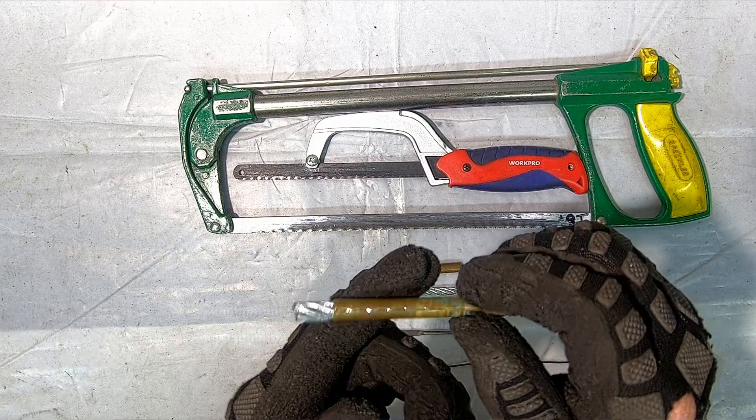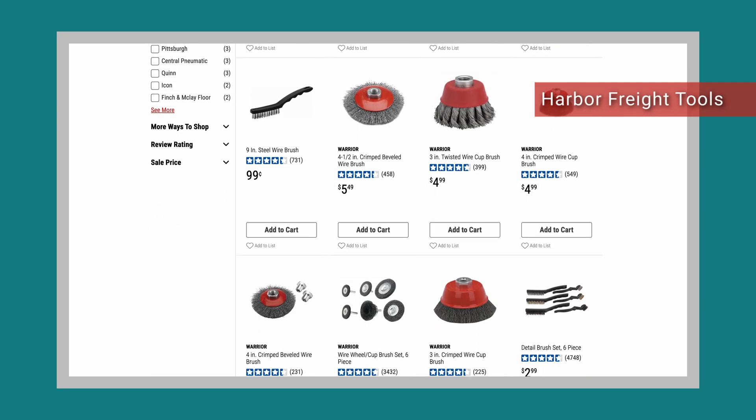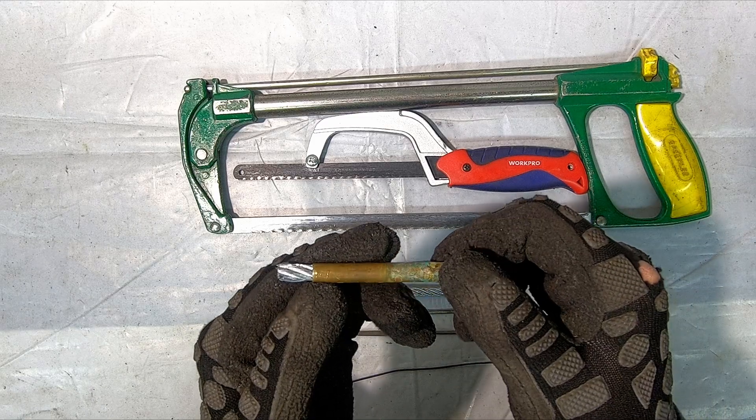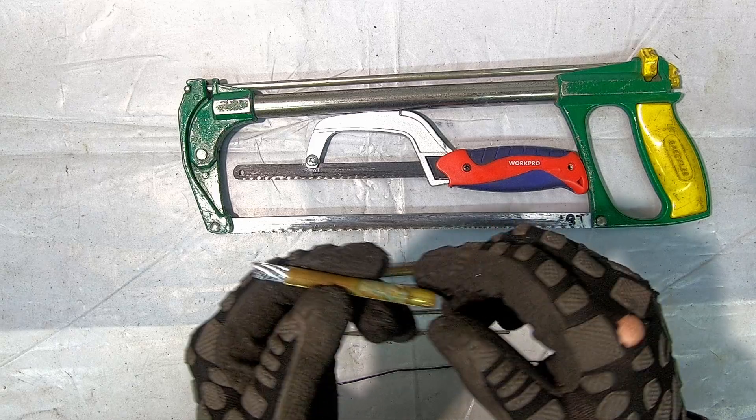The reason I use them is sometimes when you're cleaning parts on a car, there's a recessed area and you can't get in there with most of your standard wire brushes you buy at the local hardware store. So sometimes you have to improvise, and one of the ways to improvise is making one of these. You chuck this up in a drill and you can get in small places. We're going to talk about making your own because that way you get the size you want. You can make it any way you want - shorter lead or longer lead. It's real simple and easy to do. We're making a mini wire brush for getting into tight locations - you just chuck it up in your drill and you can get into those tiny places.